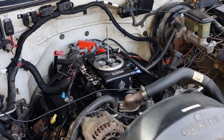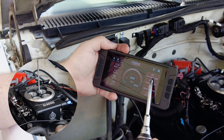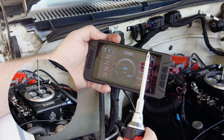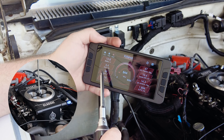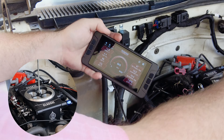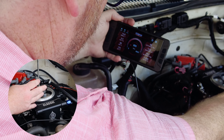We can see we're up to temperature pretty well. We've got right around our target, which is about 850 RPM, but our IAC position is kind of high — we're at 46 IAC, and there's no fans on. This is the point you really want to adjust it before the fans kick on, so I'll take my screwdriver and we're going to turn this curb idle screw in.